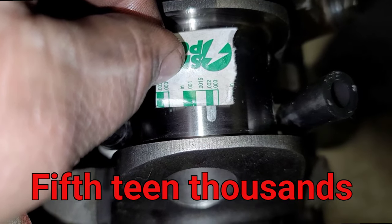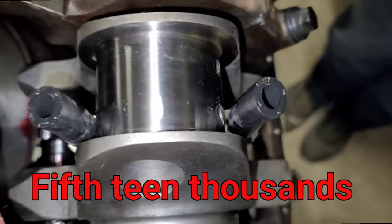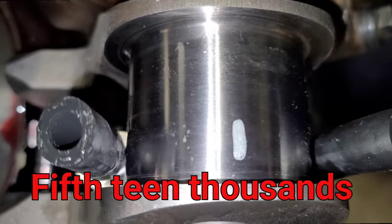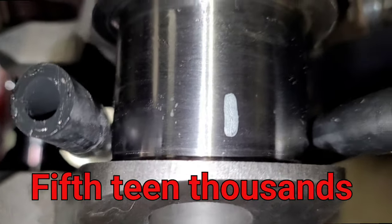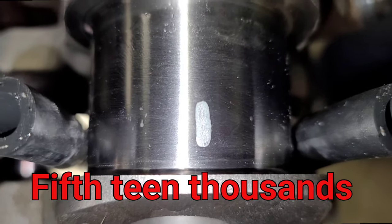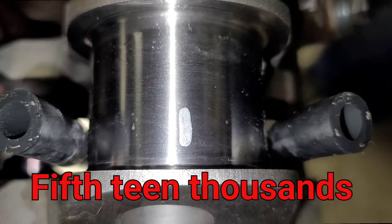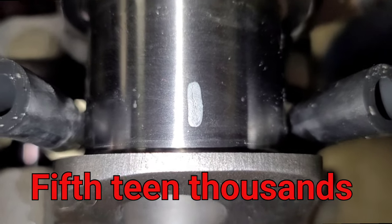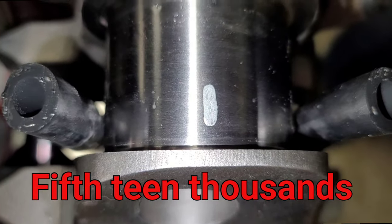I really would have wanted to be closer to 2, just because that's what I did last time and it worked really well. But I believe factory spec is 1.5 thou. Pretty sure my buddy who's running 800 horsepower on a boosted 351 Windsor is running 1.5 thou. So we should be pretty good. A little tighter than I wanted, but I mean, beggars can't be choosers.